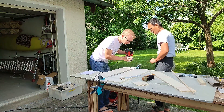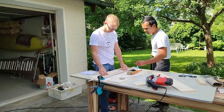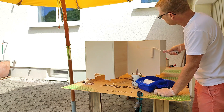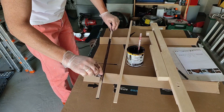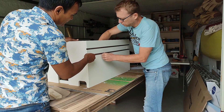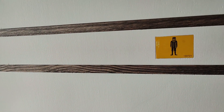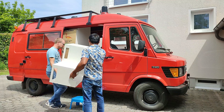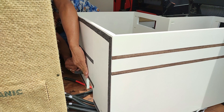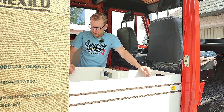The front of the dinette still needs two strips which have become the trademark for our interior. We use the routing machine to cut two lines into which we later insert small pine slats. The box then gets two layers of paint — first one layer of Osmo Decor Wax, then after sanding, one layer of Osmo Hard Wax. The pine slats get a thin layer of Osmo Decor Wax in ebony black. Once the paint has dried we glue the pine slats into position. The dinette also gets one of the old badges from the former firetruck boxes as a souvenir. Before placing it in its final position, we add self-adhesive felt to prevent squeaks and rattles between the dinette panels and the toilet. Our dinette slash electric box is now in place and fits very well.